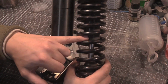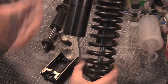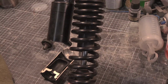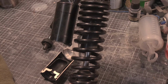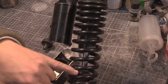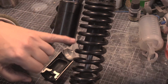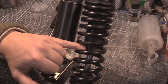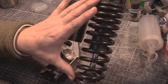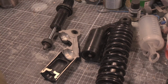You can see that that fits inside there. This is your damping rod assembly inside there, and you have your spring. People might call this a progressive spring, if you like. There is only one progressive bit, really. You have these coils and then these coils, so you'd call this a twin rate spring. The progressive bit is in the middle, when it transitions from one to the other. It doesn't squish this first or this first; both get squished, just at different rates.